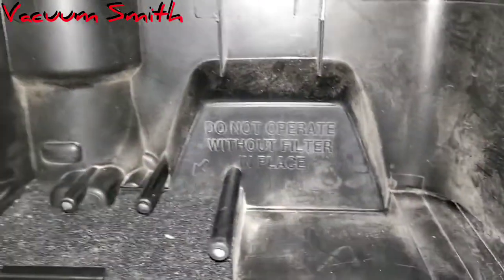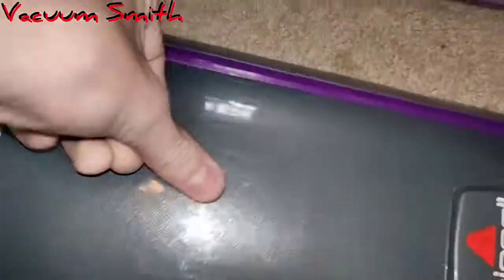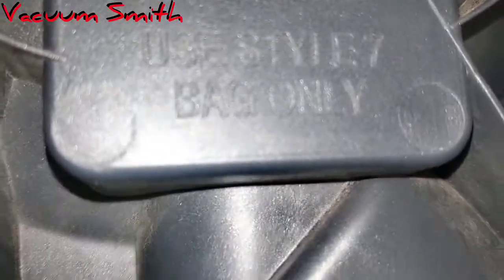Inside the bag board, it's interesting — both have brand new vacuum bags and both use Style 7 bags, and both have the same instructions. What's odd is the Power Force has these support ribs inside so the bag doesn't suck in, but the Power Lifter is missing them entirely. Also, the Power Force has five holes while the Power Lifter only has three, and it also has the pre-motor filter.